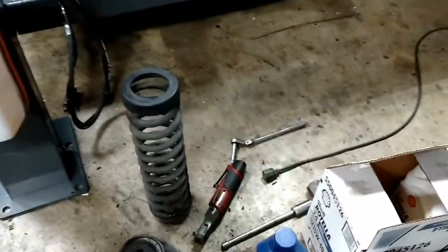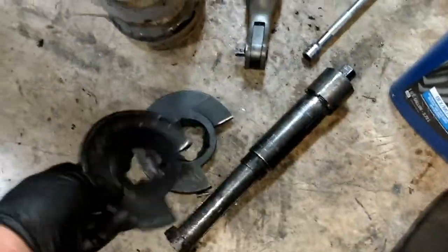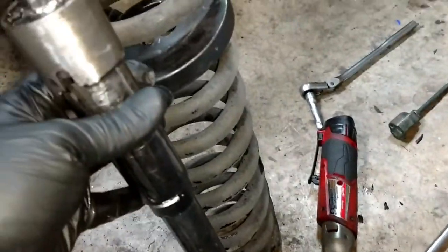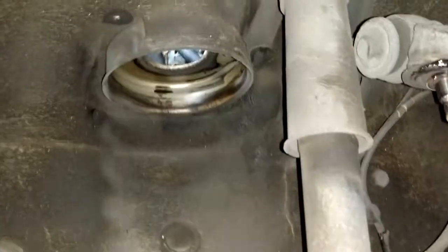We're back at it — I left off yesterday. I had to pull the springs so I could get the brake control rod housing out and undo the upper control arm and lower control arm ball joints. I've used a spring compressor — here's the spring compressor, here are the plates. You just pop those plates in there, the spring compressor goes down through there, and you turn the bolt and it will tighten the spring together. The spring is out.